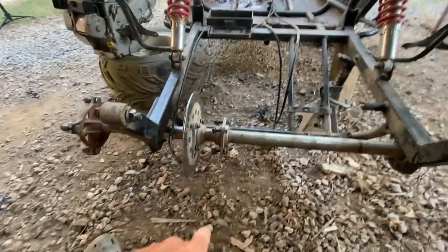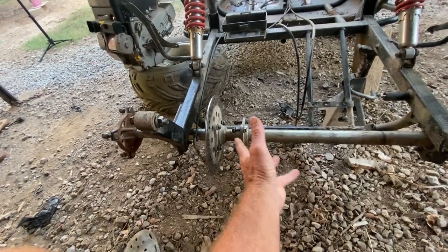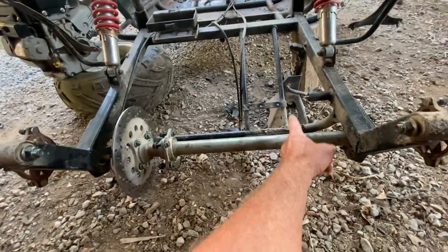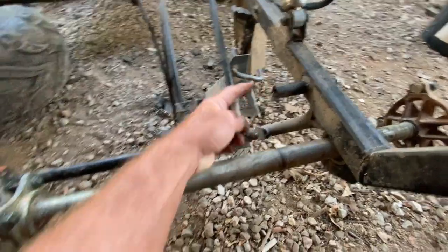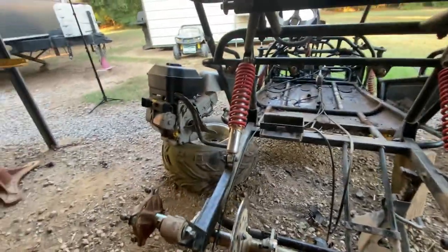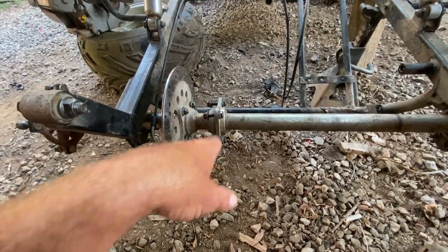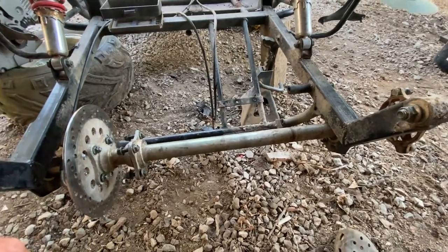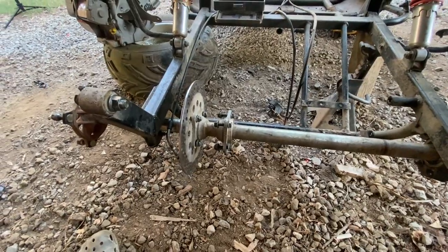Back here on the back, your axle is originally flipped over, and your brake master cylinder caliper is mounted over here to this little bracket. In order to put one of these other style engines on there, you just flip the axle. When I go to put my sprocket on I've got to remove this axle - I'll show y'all up close how you get the axle out of here, it's not that much to it. You just flip the axle on them.